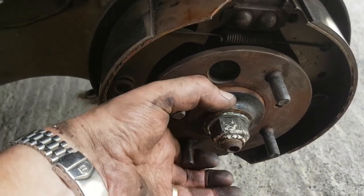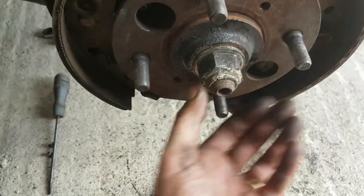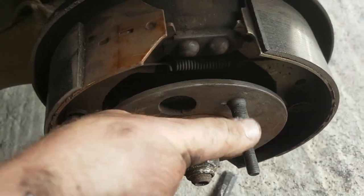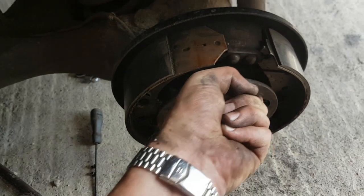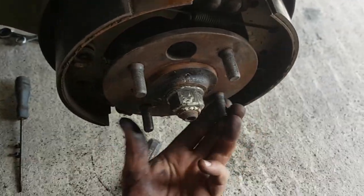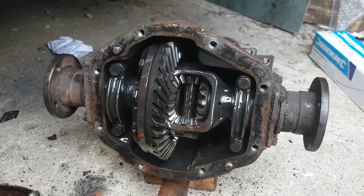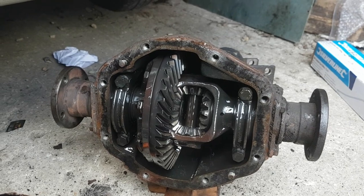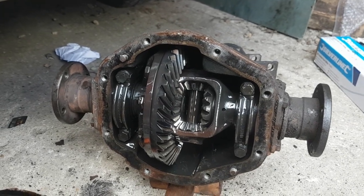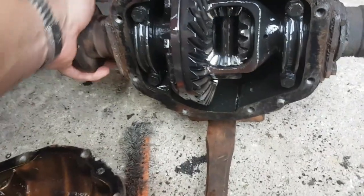The prognosis is the differential. Something's gone badly wrong in the differential. It turns in a forward direction quite happily, but in reverse it is really tough to turn. We're in neutral on the gearbox — there's no reason why that should be tough. The diff came out of the car; the rest should be straightforward. Luckily it had a stainless exhaust so I was able to tear that apart. Oddly enough, as the diff came out of the car it started to behave — no problems at all.